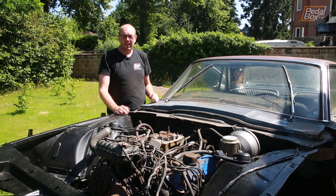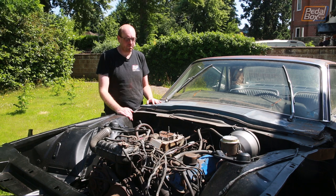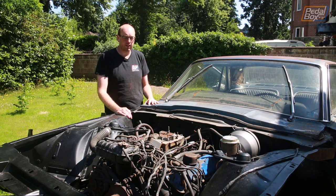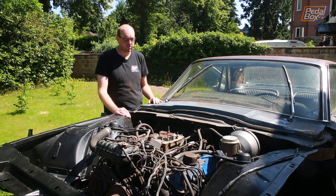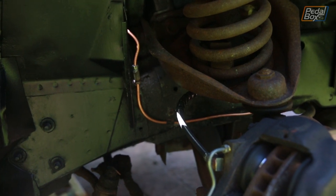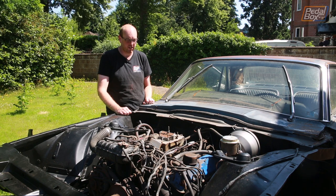So we can go fill it up with petrol and call it a day. That ends another good couple of days work on the Thunderbird. I'm really pleased to have got the fuel tank out and back in with so little faff — everything we had to remove just didn't look like fun from the manual, but it actually dropped out and back in again really really easily. And it wasn't even in as bad condition as it could have been — the line was pretty clear, the tank had some rubbish in it but it all came out pretty nicely. I think having four gallons of fuel just left in it has actually saved the bottom of the tank from condensation and rust, so we'll call that a win. And we've actually managed to finish the brake system after all this time — getting the new booster rebuilt, installed, and building up the new hard lines across the front of the car. That is a really big win — one step closer to this car actually being able to drive out of the driveway.